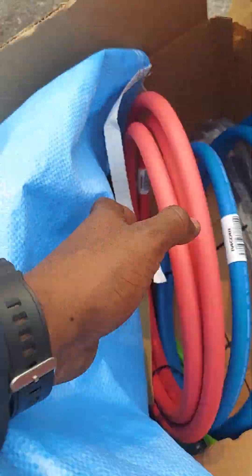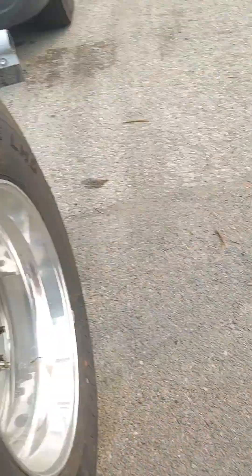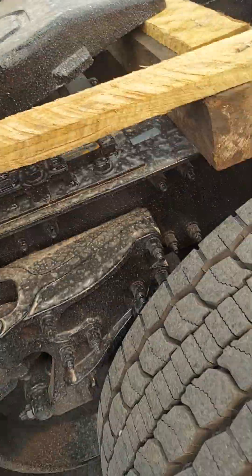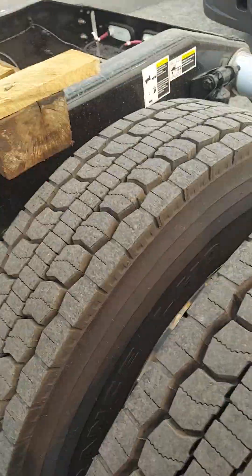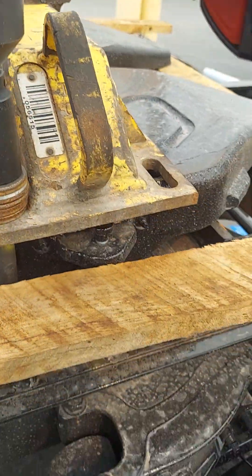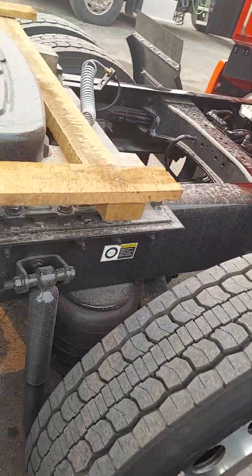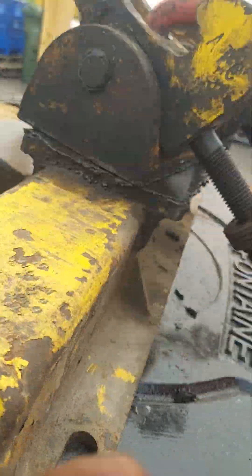You see guys, all this stuff I gotta install on my truck right here — I gotta install the airlines. It's pretty easy. I'm gonna get my impact gun, and this is the socket you need: one and a quarter inch for these bolts to release the saddle. I'm gonna release the saddle — there you go, that is released. Let me do it on both sides. I'm gonna pull you — I got it.